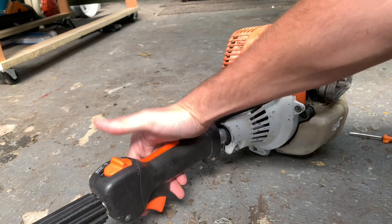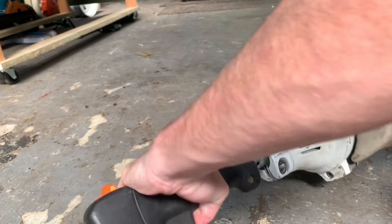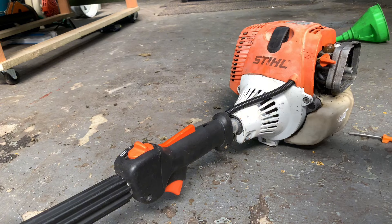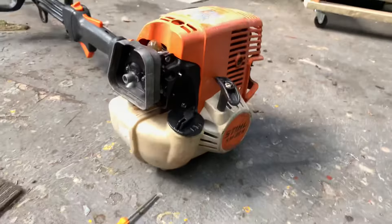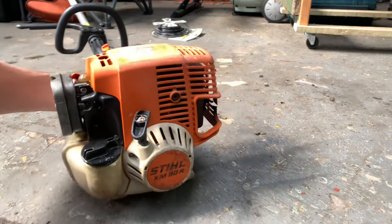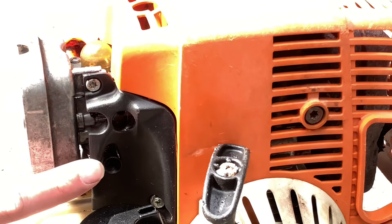It's warm now so I'll just start it from the start position — I won't choke it or anything. Might need to give it a bit of throttle. But you know how straight away it just dies? So that's when you get your trusty tool. This bottom one here is the one we'll be adjusting.